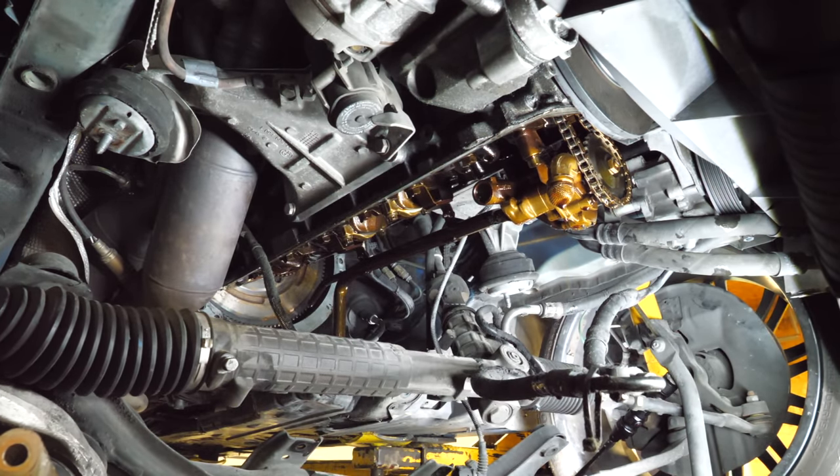Now we're going to get a ratchet and make sure that's tight. Now we're tight. Time to zip the sway bar up. Now I can fit most of my fingers between the pan and the bar — whereas before that oil pan was resting on the bar. It actually wore a spot in the bar — I might try to find a replacement. Unfortunately, I had to install some aftermarket cable ties. There's a rubber bushing that holds this power steering line to this bracket and it's broken — this is super common on old rubber bushings that have to hold any kind of weight. They get soaked in oil or fluid, heat cycles, age — everything ruins them. So I will look to see if I can replace that rubber piece so that this can be properly mounted. I also noticed that instead of band clamps, someone used zip ties on the steering rack bellows — I'll be replacing those with the proper metal bands.